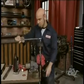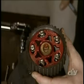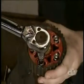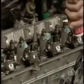When you're finished, adjust the cam gear so that their timing marks are set to 0, and tighten all 5 of the adjustment bolts to 15 foot-pounds each. Then, take the cams to the engine for the install. Before you install the cams, apply a liberal coat of assembly lube to help break in the parts gently.